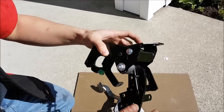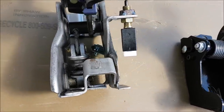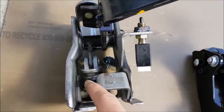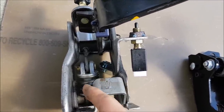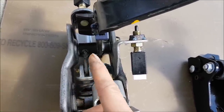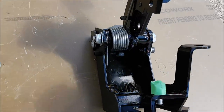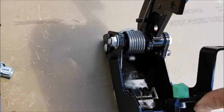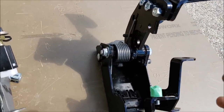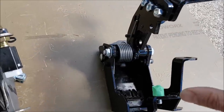This spring design comes back naturally on its own — this is going to make your hydraulic system last a lot longer. Looking at the return spring assembly, you can see how very different they are. When this is out of the car and you don't have the clutch hydraulic system pushing it out, how can it really return on its own smoothly? It's requiring the spring to push up, but it just goes at an angle — it's not like a piston action, just linkage. This design inherently will make the pedal a little heavier, but we're going to get a lot smoother modulation because of it.